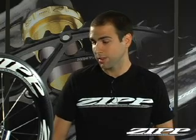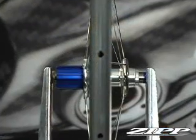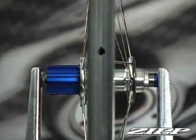So using the new lacing, we actually moved everything over by over 1mm to the right, which might not sound like much, but in terms of a bicycle hub, it actually is quite a bit. What that does is over the 08 wheels, the 09s are actually, the non-drive spoke tension is almost doubled, which just gives you a better balanced wheel and just less chance of breaking a spoke.